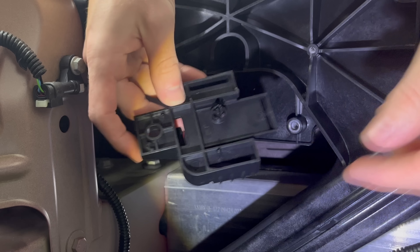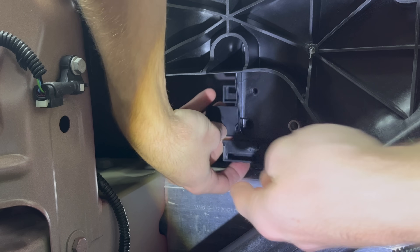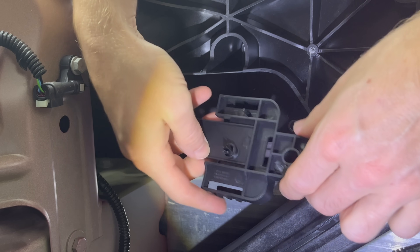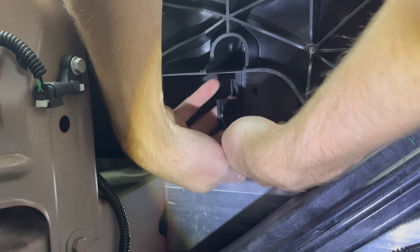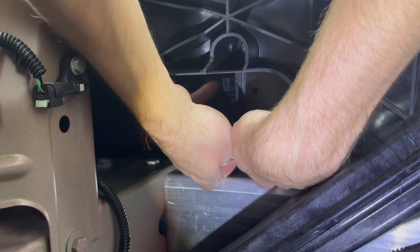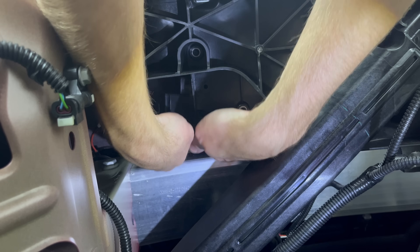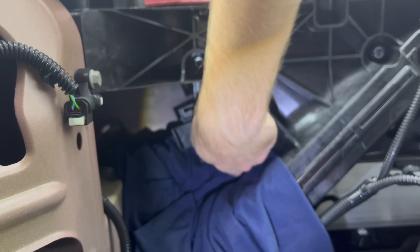To be honest, this is the hardest part of the install — putting this bracket on the front part of the bumper. I've seen a lot of people install this up front; it may work, it may not. I'm assuming it has to go front so the Home Link gets a better signal through the front bumper. There are a couple of little grooves in that bracket that should fit those pre-drilled holes, however it doesn't really snap in well. You have to put the screw through the front area which is extremely difficult, especially if you have larger hands. I also put a t-shirt there to prevent the screw from dropping down, which did happen once.